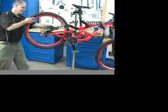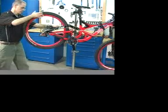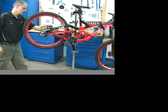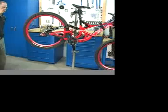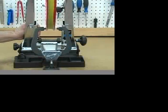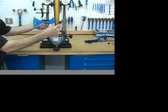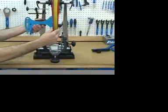Inspect front and rear hubs. Grab rim and pull laterally side to side, checking for play. Spin wheel and feel for worn bearings. Service hubs as necessary. Rotate wheels while secured to the frame, fork, or in a truing stand. Check your rims for any lateral or radial deviations or damage. Have a professional mechanic check your wheels for proper spoke tension and spoke tension balancing.